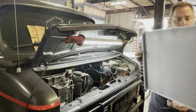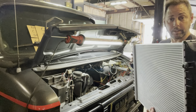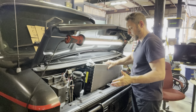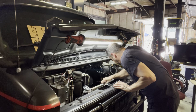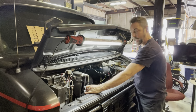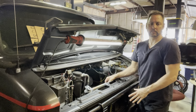This is the radiator and it weighs so little compared to the original. Let's see how it fits in. I've actually test fitted already one time with the fans in place, so I know it goes in with plenty of room. The width and the height is just about perfect really. There's the height as it's sitting on the cross member - it's not sitting level, but once we make the mounts, we just need to ensure that it is not touching or vibrating against the metal.